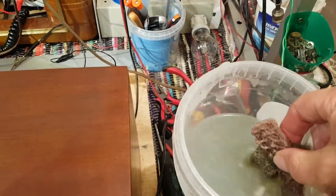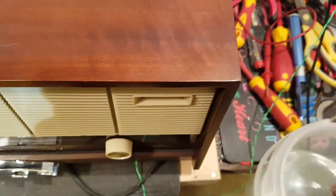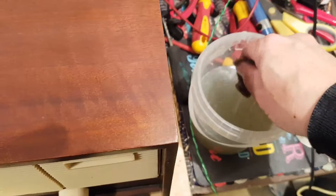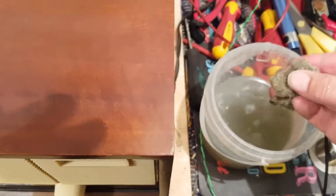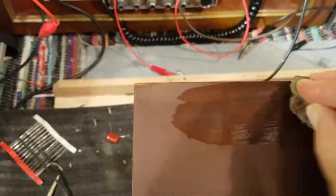So what I have over here — that's a solution of good old washing soap, the kind you put in your washing machine, the liquid type, and scotch-brite. So I have a scotch-brite pad, but this is a worn-out scotch-brite, it's not fresh, so it's not so aggressive. But it certainly is going to get in here and remove that old harsh buildup — those 55 years of polish and wax, which eventually just doesn't shine up anymore. It's just too degraded.